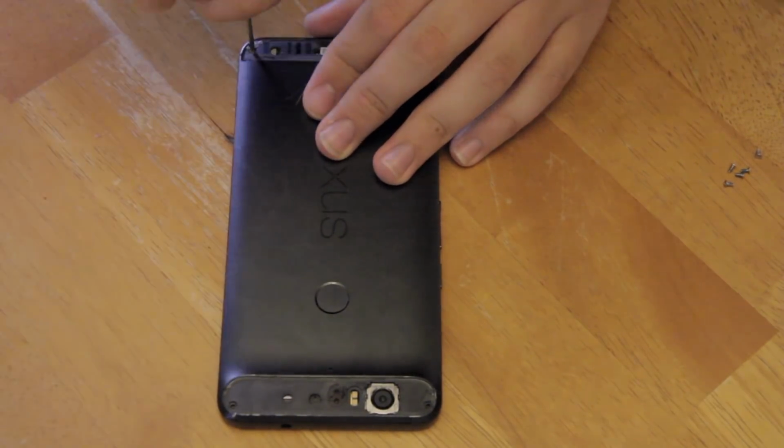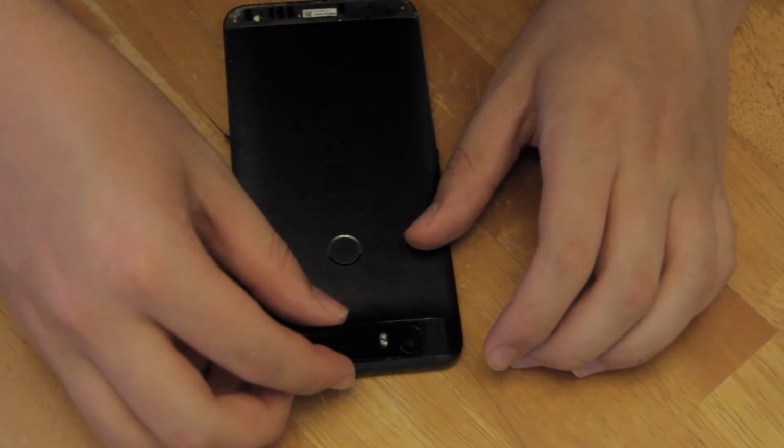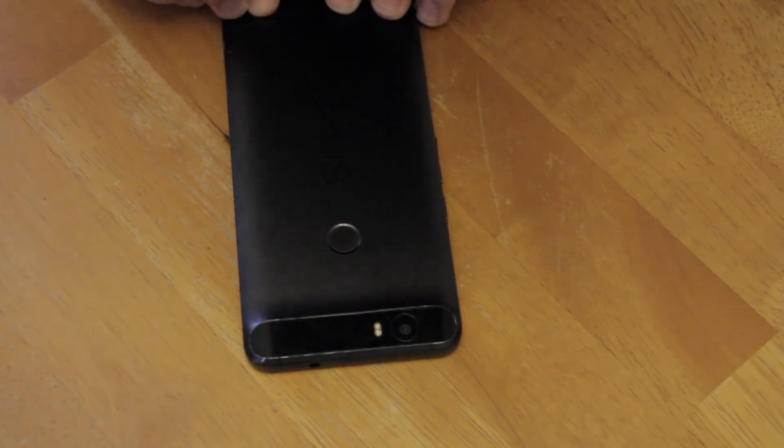You can now put the 6 screws back into the rear of the phone. You don't have to worry about putting them in the wrong holes because they're all exactly the same length. You can now place the glass piece back over the camera and press it down to reattach it to the adhesive underneath. Do the same for the plastic piece on the bottom of the phone.